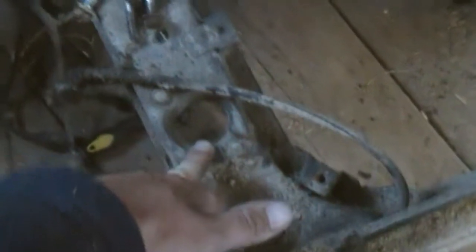So yeah, there, it's almost stripped, this Odyssey. Yeah, you see, to get the axle out, we had 1, 2, 3, 4 bolts. Sorry about that. 4 bolts on the gearbox side, 2 bolts on the other side. Very simple. 3 bolts for the motor. Yeah, very simple. Which I hope I can find that, or Honda still makes it, which probably not. That one's still good, but that one's just hooped.